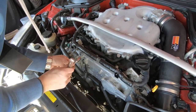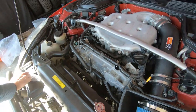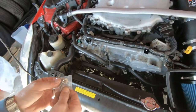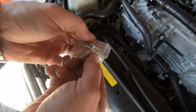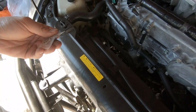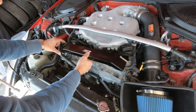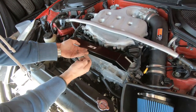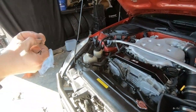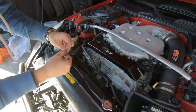I'm going ahead and putting this ground wire back in — it's not in the way so I'm not sure why we had to remove it. I've got these little pieces of hardware here — little countersunk washers — and you need an Allen key to get those in. They are actually 2mm Allen key — small pieces of hardware, so don't drop them in the engine bay because you will not find them.